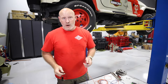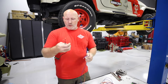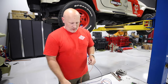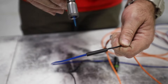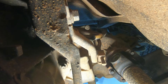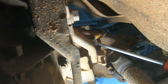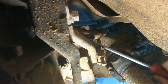The next step is to take our new plug for our new sensor and wire it into the extension wires. It doesn't really matter which wire goes to which according to this, so just wire one to the other, then wire it up to the front, plug it in and see how it goes. I'm connecting the wires with butt splice connectors and then covering them with heat shrink — you could also use solder if you really wanted to. There's not a great camera angle for the sensor and the plug, but here we are at the transfer case on the driver's side. On top you'll see wiring coming in and connecting a plug to the transfer case sensor. It's a little hard to reach and chances are you're not going to be able to unplug it by hand, so I'm using a long flathead screwdriver to push it up.